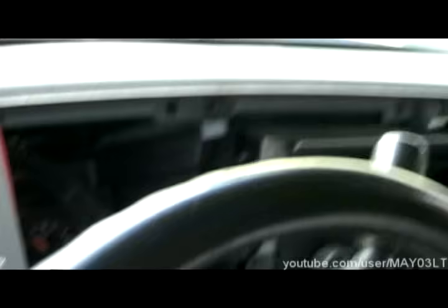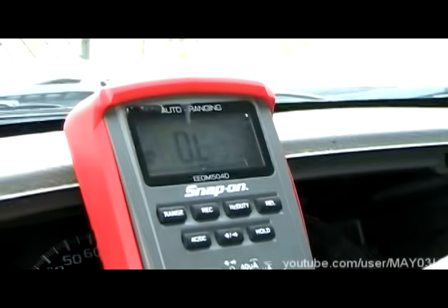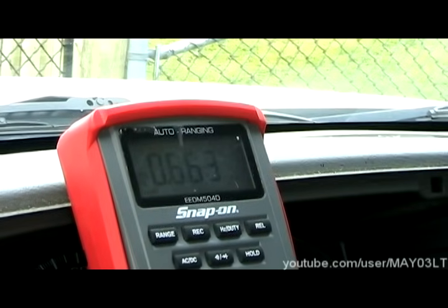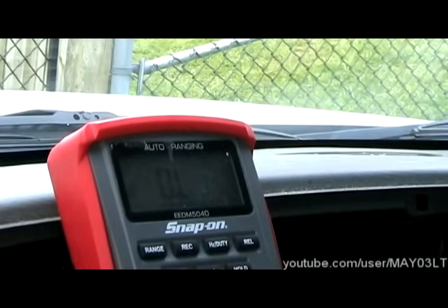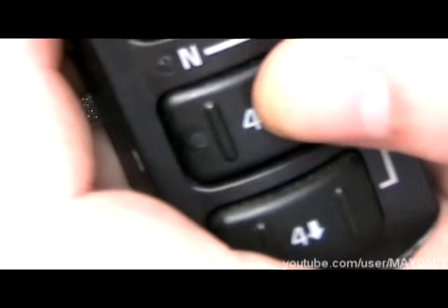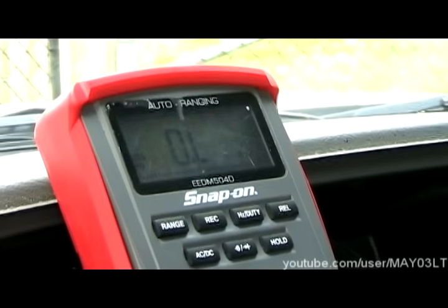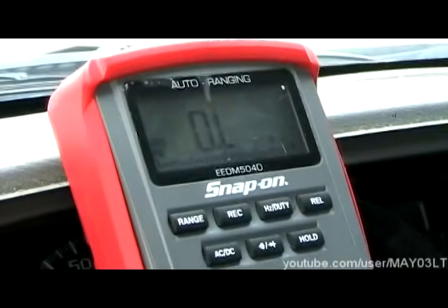Our spec is 1.5 to 1.53, so that looks okay. Do the same test for auto four-wheel — we should be between 61.6 and 68.1 ohms, which we're good. Four high should give us between 656 and 670 ohms, and there's something wrong — it's jumping all over the place. Now we're back at our at-rest voltage, so something's going on with this switch whenever we press four high. We're also going to do four low — we should be between 2.32 and 2.37 kilo ohms, and it's not doing anything. And for neutral, you hold two high and four low down at the same time — we should get between 1.015 and 1.031 kilo ohms, and something's not right with that either. Something's messed up with the switch.